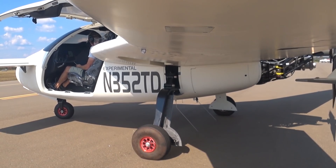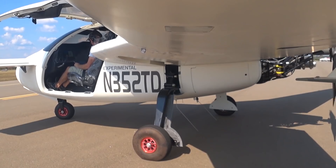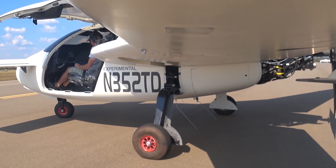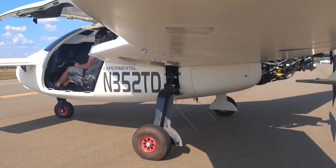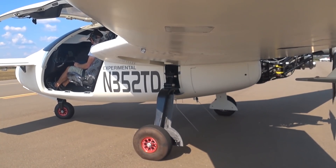The first thing I noticed when I started looking at the tuning parameters for the Audi engine was that the original map was only using half of the fuel pressure available on the high-pressure fuel pump — only ever using 95 megapascals when the pump is capable of 200 megapascals. What that means is the injection cycles are basically running twice as long as they need to, and that's why I've been getting high EGTs and seeing smoke — the fuel is just taking too long to be injected. I'm learning how to tune all this and there's still quite a bit of work to go, but it's exciting to see there's definitely more power to be had.